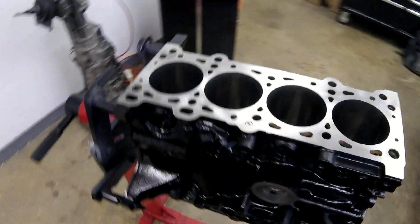All right, so we have our engine block. First thing: cleaning. Cleaning is not a suggestion — cleaning is a requirement. It's the most important thing you need to do when you're building a motor. Take it from someone who has done it the wrong way: when a tiny little metal shaving gets into the right place at the right time, no more motor. When the block comes back from the machinist it's usually still pretty dirty. My machinist leaves the cutting fluid on it to prevent the block from flash rusting on the way back.